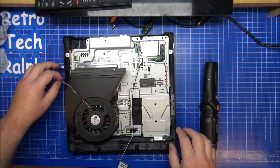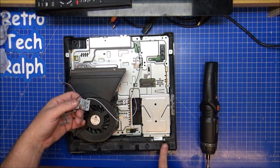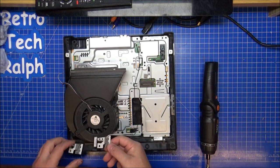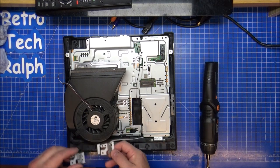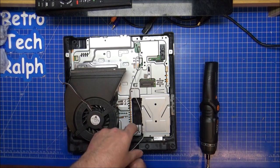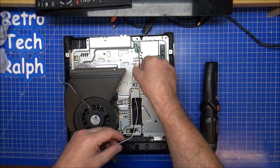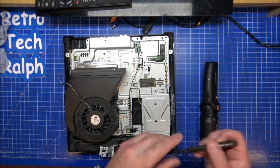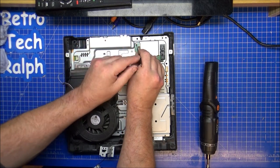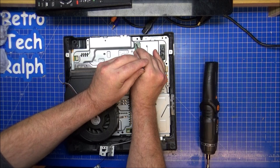Now, I'm actually jumping forward a little bit. Remove the ribbon cable from here, put it back onto the control panel so I don't forget where it is. The Bluetooth and the wireless, these have been unscrewed from the front here. Simple Phillips screw on the front of there. Tip these off, unravel from where it's wound behind, around here, here, here, up to there, and then gently, get a pair of tweezers, pull them off of the board. Just nice and gently, not to drag it or anything.